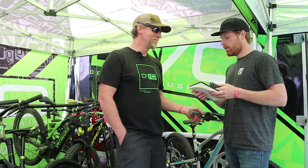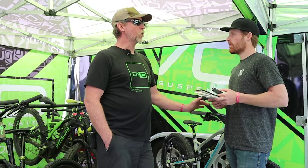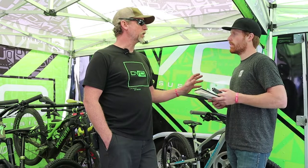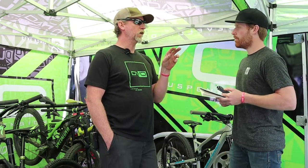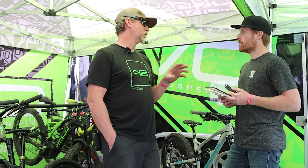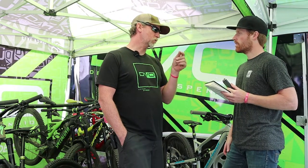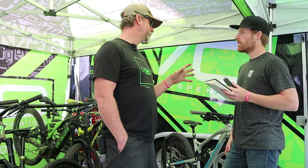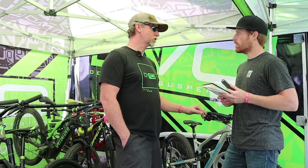And when did you decide to use an IFP versus a bladder? We were looking at it when we first started DVO. It was more towards the gravity side of things. We came out with the Emerald front fork, and then a shock that was going to be a downhill race shock. We looked at moto technologies, and many motorcycle shocks use bladders because they don't have any breakaway force, whereas an IFP has that static stiction, the initial breakaway force, like the negative and positive pressure we talked about, which takes away some suppleness. The bladder is like squeezing a balloon, with no resistance at the beginning. It was just to make a super plush race shock at the beginning, but it works throughout all products.